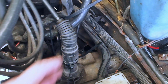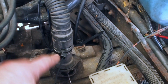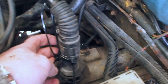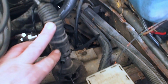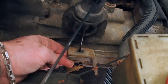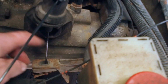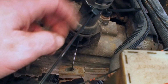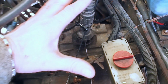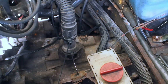Okay, so I've had to make up a contraption with 4 cable ties, one at the top, one at the bottom, and then squash it down so it retracts. The reason you do that is that it lets you see the free play. Now that I have that play down here, I can take it off and put it on, because otherwise it's under tension, and to force it off, the spring kind of goes up, and trying to get it back down again, the tension is an absolute mission. You more or less might have to get a new one.